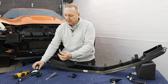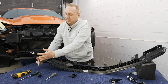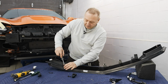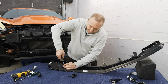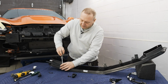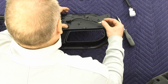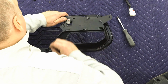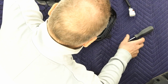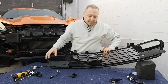You will be keeping this, because depending on the model years, there's actually different types of connectors. So GM has done a modular design. But this will now let me go through the bezel itself. So next, a small Phillips. Taking out the 2 small Phillips screws at the extreme corner of the camera. And that lets me slide right through it. And now I've got the camera removed. Perfect. We'll do the same to the other side and basically walk away with 2 cameras.